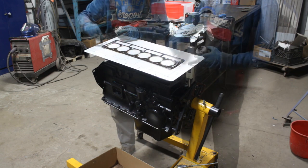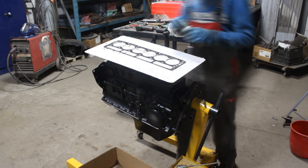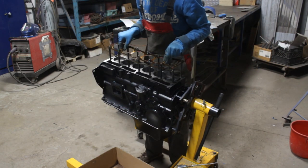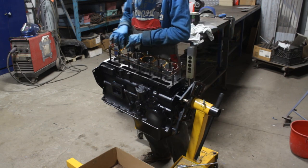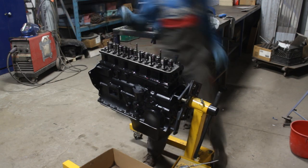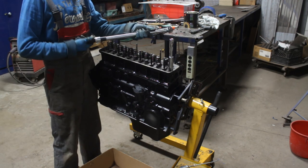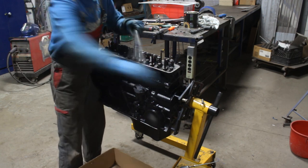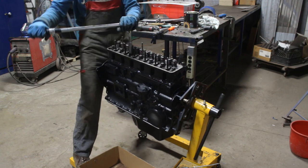In this specific case, if you remember, the engine wasn't showing any oil pressure on the gauge when I was running it before I took it apart. I believe that was an issue with the gauge or something else because I checked the oil pump and there was nothing wrong with it. Still, I want to make sure it's running well before I start the engine, so I'm planning to prime it — I'm going to drop a shaft into the opening for the distributor and drive the oil pump with my drill to make sure there's oil pressure on the gauge and that the oil fills up the filter and goes all over the engine before I attempt starting it for the first time.